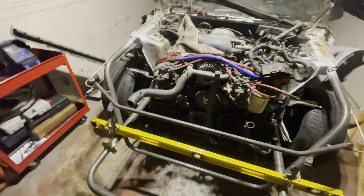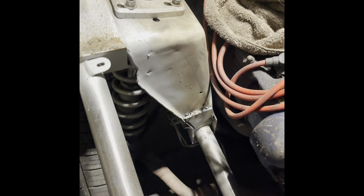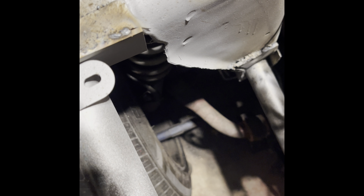Well, boys — she's tacked. That's literally only tack welded in and it's pretty damn solid. I'm moving the whole car with it. This is extremely hard to weld, guys — it burns through very, very easily, so that's something to keep in mind. Already it's not going to look too great, as you can tell, but we'll get her done. It is what it is. And so we are done — this thing is not going anywhere. I'm literally shaking the whole car and about to pull it off the jack stands. There's no way it's going anywhere — it's welded at the bottom, the top, on both sides.